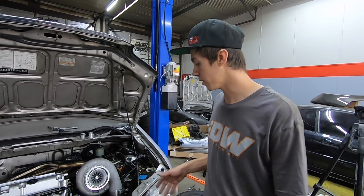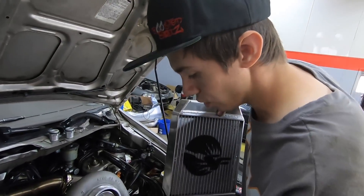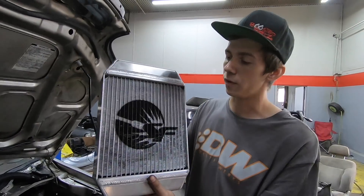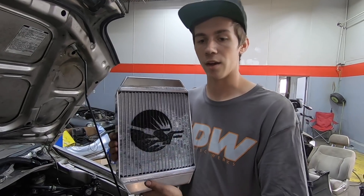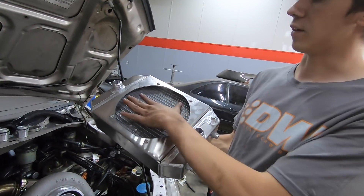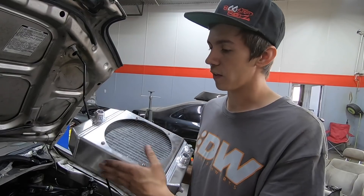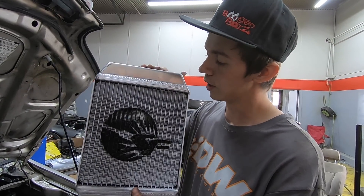Right now I'm getting ready to mock up where it's going to go, get some tabs welded on to our traction bar, and it will just bolt to the bottom on these bungs it comes with. We did a test — we filled this one up completely with water and the stock one as well, and this actually holds more water than the eBay half-size radiator. It holds more fluid, and we have the shroud with a high-flow fan so it can draw more air. Between this, the new head gasket, and taking the thermostat out, we're hoping we won't have any more overheating problems. Shout out to Speed Factory Racing for this radiator.